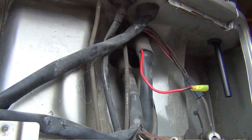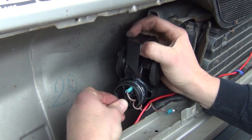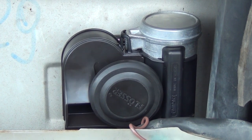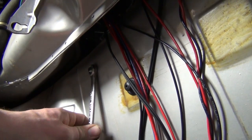Run this wire across the front of the van using the present factory wiring harness clips, and connect it to the positive terminal of the horn. The horn can now be tightened into place — be sure the horn body stays perpendicular to the ground when bolted in.